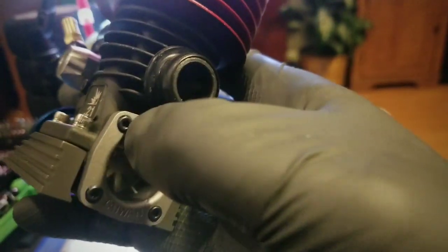This new motor mounts on. That's what it looked like. Now, what I did and what I recommend is you guys put Loctite. I put Loctite on those bolts and on those bolts because this right here gets hot and it's violent and it's always vibrating. So these bolts will actually vibrate loose.